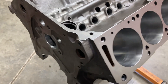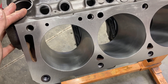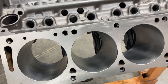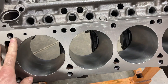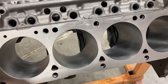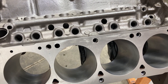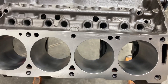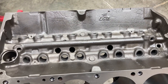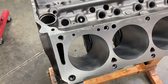All the machine work has been done to this one. It's a 4.250 bore — standard bore on a 427 is 4.233, so we took this one out 17 thousandths. It just needed a little bit to be cleaned up. This block needed a lot of work — somebody had decked it quite a bit before and we had to take another 5 thousandths off of it to get it straight. The deck is parallel to the crankshaft centerline, which is very important. It's currently sitting at a 10.135 deck height, which is quite a bit under factory deck height for an FE. We'll have to do some tricks later on to make sure we don't cause ourselves problems with push rod clearance inside the tunnel port intake.